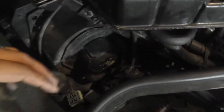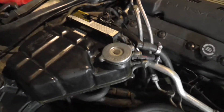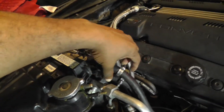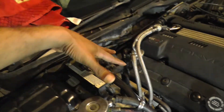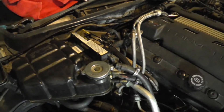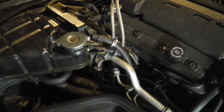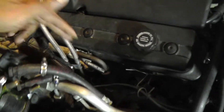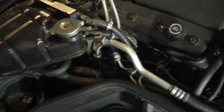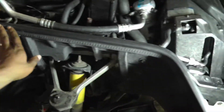That exposes your blower box and your windshield wiper fluid. Since I have to get to the AC evaporator inside this box, I have to pull off this entire assembly. You won't have to do this — you can reach the exhaust manifold bolts, those rear ones, from the bottom once the catalytic converter is out. I'm just not going that route. To pull this off I'm going to have to take off this inner fender, which is one assembly.